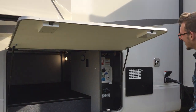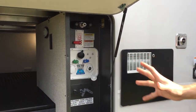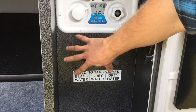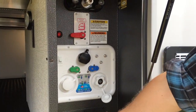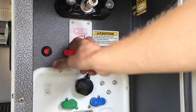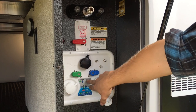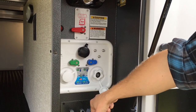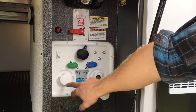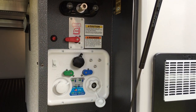Here's your control center — pretty standard in a lot of fifth wheels now. You've got your two gray tanks and one black water tank right here. Everything is here: city water connection, tank flush and fill for winterizing, your bypass valve. For winterizing you just flip that the other way — instructions are on here for tank fill, city water, winterize, dry camp, and so on. There's a little pump here for sucking antifreeze into the system for winterizing — flip that switch, red light comes on. And an outdoor shower, plus a little plug for a solar trickle charger — separate from the roof solar system.